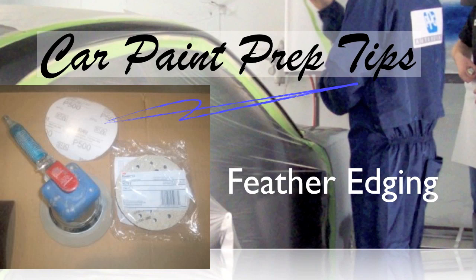For this example, we're going to say it's sanded with 150 and it's ready for primer. However, where you ground the paint to put the body filler, that edge is very hard. We need to smooth that out. Also, when you were blocking, you may have scratched the paint surface with 36, 80, or 150 grit sandpaper beyond the body filler area, and those scratches need to be smoothed out as well. So these areas are going to have to be sanded out — this is called feather edging.